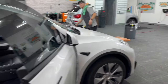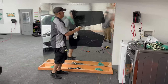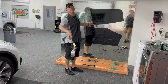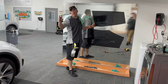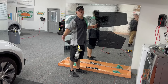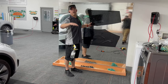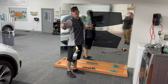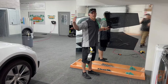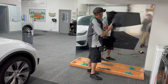Outside. This car is always outside. Okay. But which direction do you park it in? Where's your exact parking spot? How much sun is it getting on one side compared to the other? Depending on all that, one side could fail while another doesn't, because the other doesn't see sun. Same thing happens to paint. You see someone's car who parks next to their yard every single day in the same spot. One side's all messed up and faded because the sun hits it constantly, and it doesn't hit the other side. So it all depends on what side it's exposed to. But usually about 7 to 8 years.